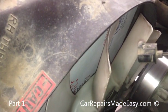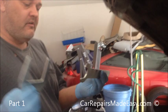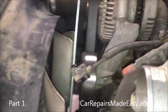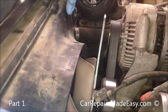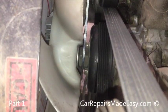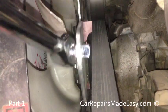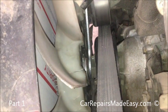Now we're going to grab our tools for taking the fan clutch off. This one goes on the nut on the fan itself, as you can see there. And this one holds onto the bolt. We're going to use a half-inch breaker bar — or you can use a half-inch ratchet, whatever you have. This should fit in here like so.